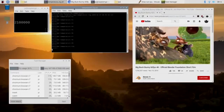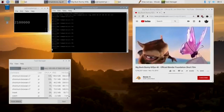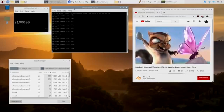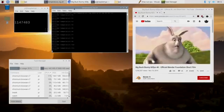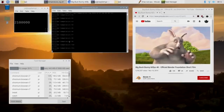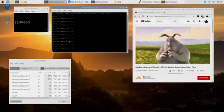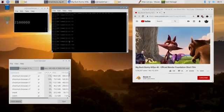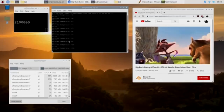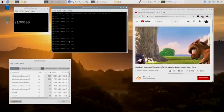So now it's time to get into some testing. I'm going to be running this at an overclock of 2.1 gigahertz, and I'm also going to test it at 1.5 gigahertz — the stock clocks — and we'll face it off against the Flirc case. I always run a little script to give me some temps in the background. I'm going to test idle temperatures, 720p YouTube video playback, temps while extracting an image, and then an extreme test that maxes out all four cores for 20 minutes straight. I'll leave a log in the background, make up some charts, and we'll be back in a sec.